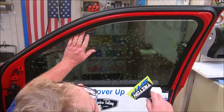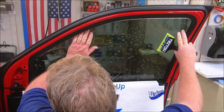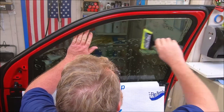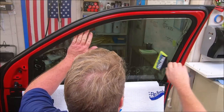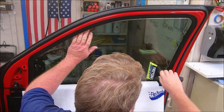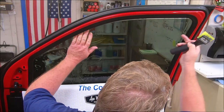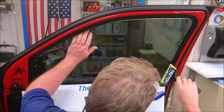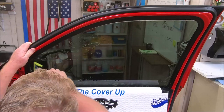This is the sledgehammer plus squeegee. You combine this with a great film and great adhesive and it allows you to do a lot of stuff that you can't do with just normal film. My first pass I'm dragging this backwards, pushing the water all the way over to right here. Notice I don't try to cram it up in there — if you cram it, it creates pressure and flushes anything out. I bring it up here and let gravity pull the moisture down.